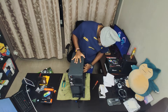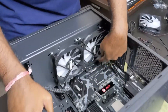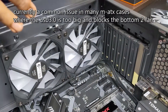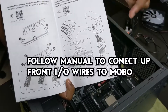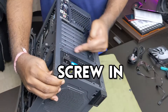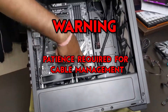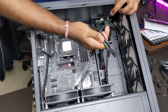I'm going to wrap things behind. I've connected up all the front IO connectors to the board. There was an issue whereby you couldn't mount the fans onto the casing because the USB 3 wire was actually blocking the fan. They have everything written down for you. I've put in the PSU — it's pretty simple, you just slot it in, screw in the four screws, and you're done. We've done a rough cable management: one cable routed up to the CPU for its power supply, and one for possibly the GPU.